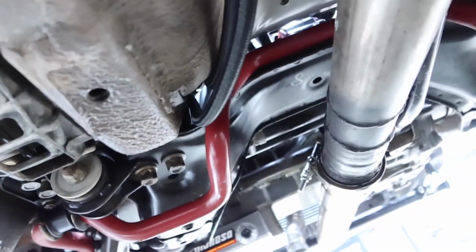Nice up there, and then they loop right up underneath the sway bar, right in between the sway bar and the subframe right here. And it's not close to the exhaust, so nothing should get hot or anything, but they're nicely all P-clamped up and out of the way. And so I think that's gonna be it for today's video. And I might actually stay and start filming the next video right now, but that's all that we're gonna include for this video is all the fuel line stuff, and I showed you I did all the vacuum lines.